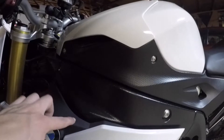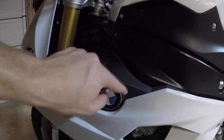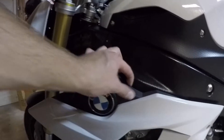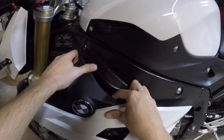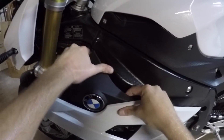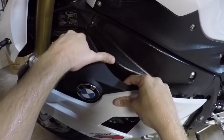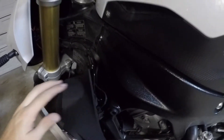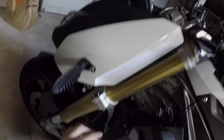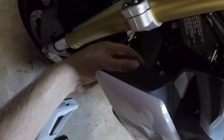Once you get this piece off — it's pretty loose at this point — there's gonna be a little rubber grommet about right here behind this panel. You're just gonna pull back on this tab right here and it'll pop right out. The first time it's gonna be a little tight, so try to get your hands behind here, give it a little shake and pull. There's another one at the front that you just pull straight out — it's just another rubber grommet that comes out pretty easy.